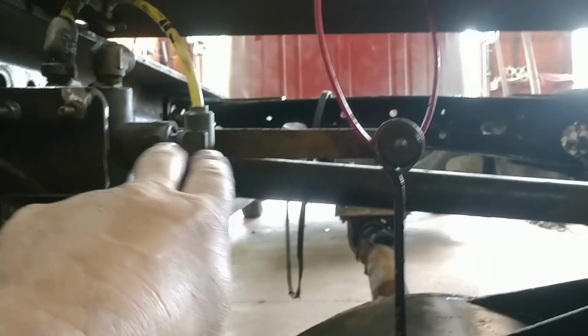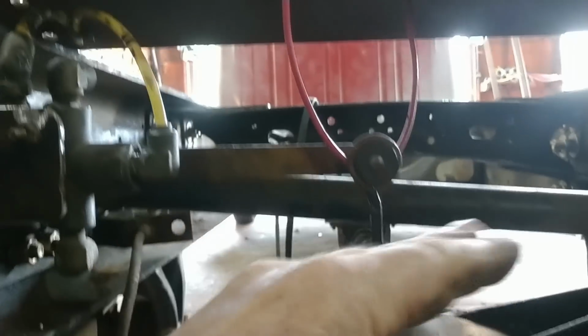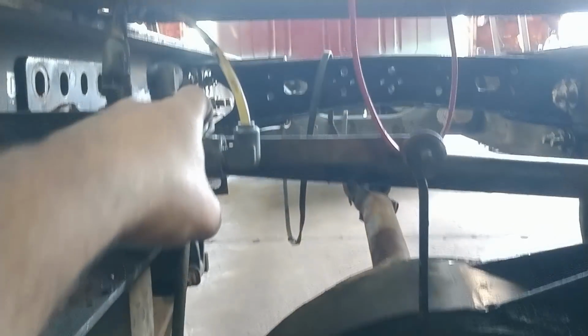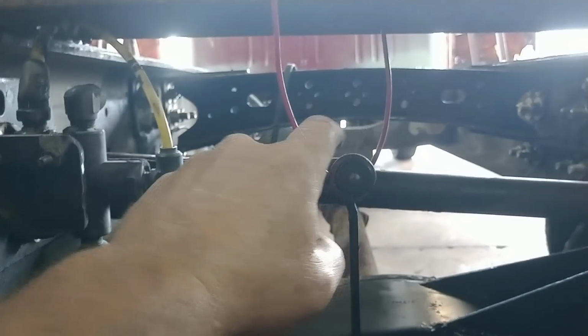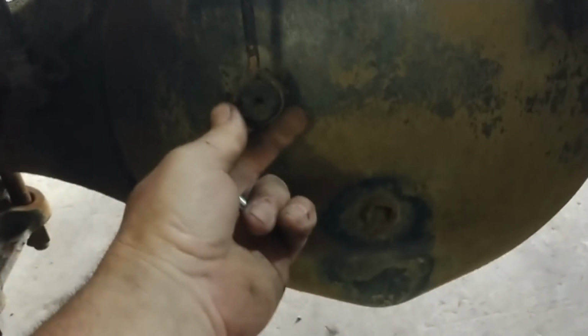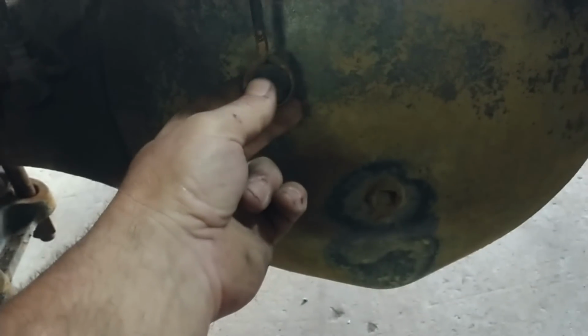this. Now, this doesn't look level. The concrete isn't level. I've laid a straight edge across the top of the frame, and the truck isn't level. So what we have to do is be relatively level. We have to be the same measurement here as we are here to this piece of steel going across the frames, because that gives us a reference line to go from, and that tells us where we want our pivot to go. I know the sunlight's kind of hurting things here, but it is what it is.